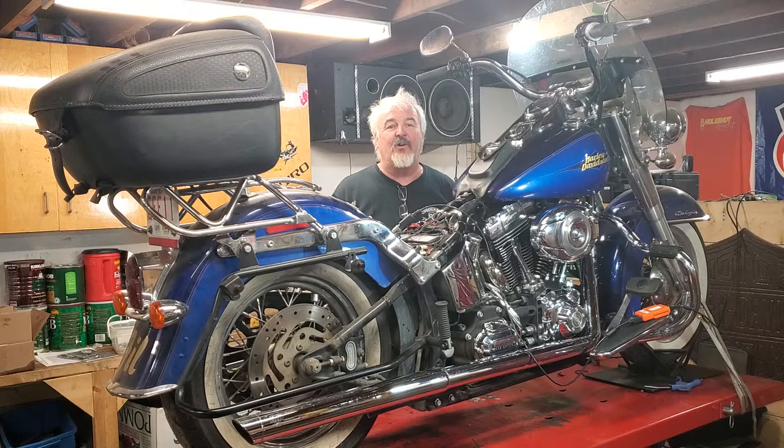On the one inner side of the cam itself, there's a sleeve that is not supposed to come off the cam, and it's your bearing surface that runs for your inner bearings that are in the case. So this sleeve had walked its way off and almost went into the inside of his cases, and that would have been catastrophic. So anyway, good time. We pulled it apart and found that.